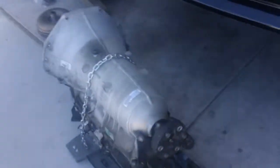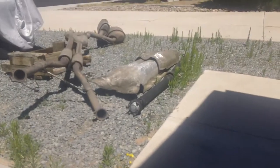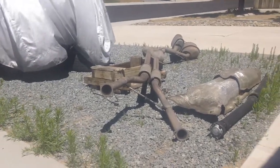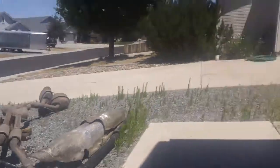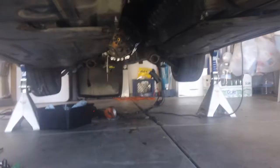I got the old one out now and I got a good used one. You got to pull off some things: I got the heat shield, the drive shaft or driveline, and the exhaust. The exhaust comes out complete except for the cats. It's kind of tight with the catalytic converters in there.